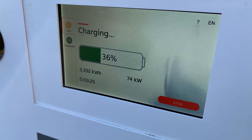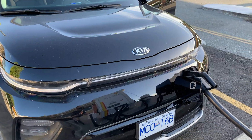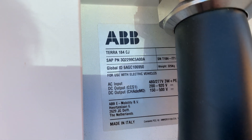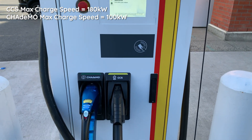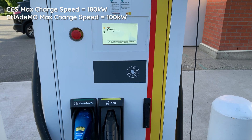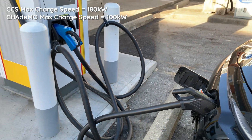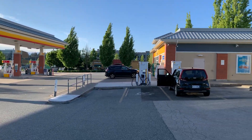Cooling has started, which means the car is taking as much power as it can and the charger is providing it — very good. The other installation is exactly the same. I think the previous ones were also ABB but much older versions, so I'm guessing these are more reliable. Both installs have CHAdeMO and CCS as standard, with the RFID scanning option. Unfortunately no pay-by-card, but both units have CCS and CHAdeMO. I'm using CCS today, and the connector is the same one FreeWire uses on their chargers.